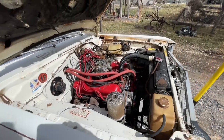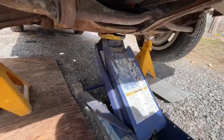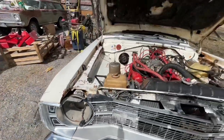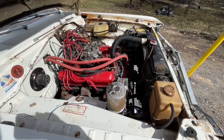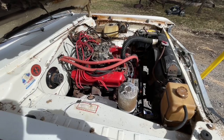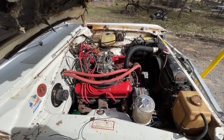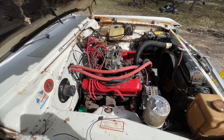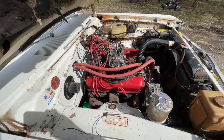There's a little thing on the K-frames of the 340 cars that was welded on - it's this little washer - and nobody really understands why they did that on the 340s, but it's there. The K-frame looks identical to just a 318 one otherwise. Anyway, I'm going to get this oil dropped, put fresh oil in, pull the valve covers so I can put some oil on there, and we're going to actually prime it properly. Pretty much any engine set for a significant amount of time really should be done this way so you don't ruin it by cranking it over with no oil.